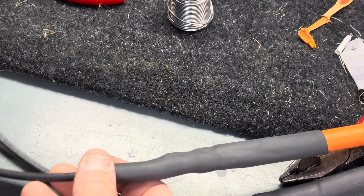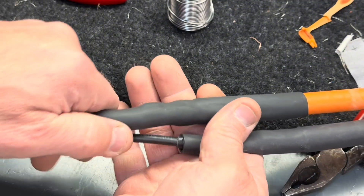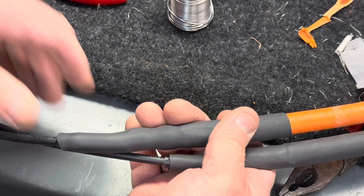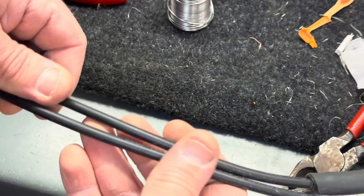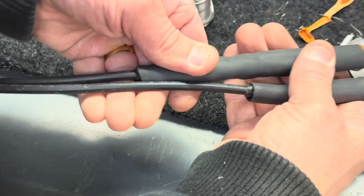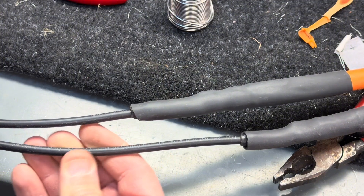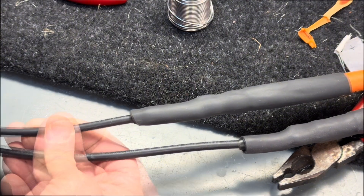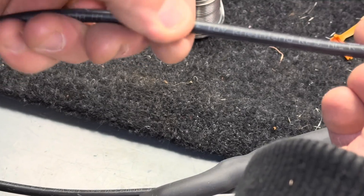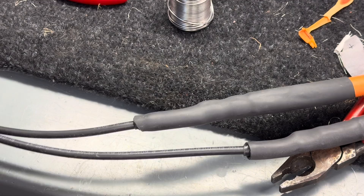I think that this will be a good, safe insulator. By the way, this is just temporary anyway until I have it in the right spot, because I will have 10mm square cables later on — not square inch, 10mm square. This is just 4mm, or actually it is 6mm square. So this will be really nice and good enough to try it out anyway.